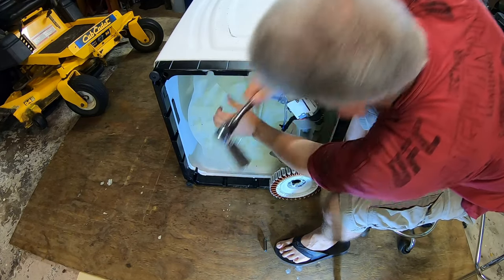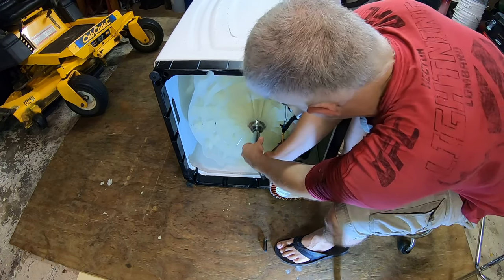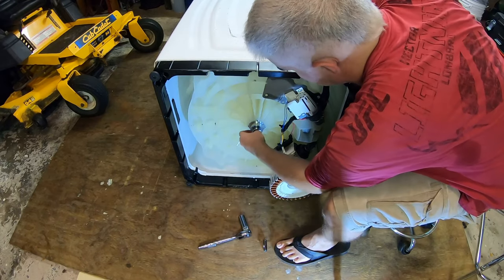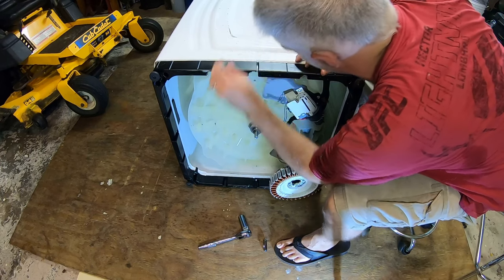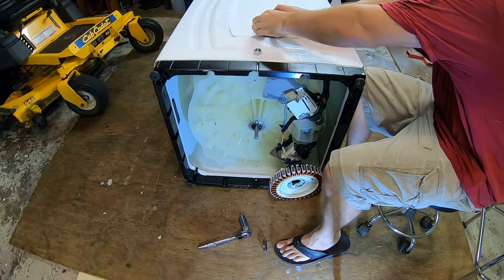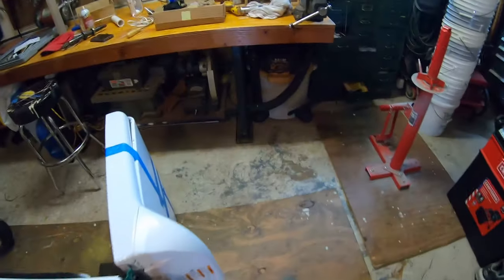And I think it's bottomed out. Let's take this out and have a look. You can just tell, you kind of hit a wall. More force doesn't really get things in there anymore. So I think we're where we need to be. So let's take the puller out for the installation tool. So that's about the depth of the prior lower bearing. And let's take a look on the top. This time I'm not going to drop you, I promise.